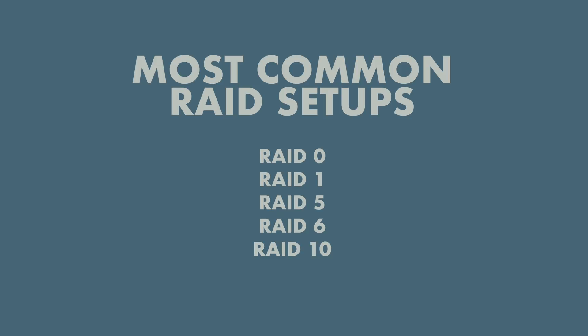There are different levels of RAID depending on the level of protection you need. The simple thing you need to remember is that you need to mirror your data if you don't want to lose it completely. RAID 0 means you will have a really fast array, but at the expense of safety — if one drive fails, you basically lose all data from all drives. That's why RAID 1, RAID 5, and basically anything other than RAID 0 exists. What you need is drive redundancy in case of failure. Once RAID is set up, the computer will read the drives as one big drive.